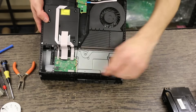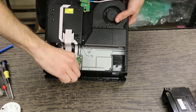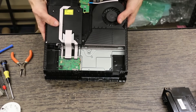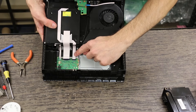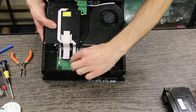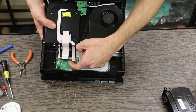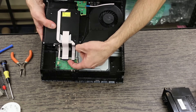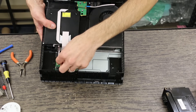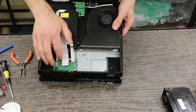Now you get a look at the connectors in here. We've got three ribbon cables and the wifi cable connector. For the wifi cable connector we're just going to take our pliers and pull it out. We've got a small cable, a large wide cable, and a medium cable. The medium cable actually just pulls straight out. The large cable you have to be a little more careful — there's a black tab here, you have to pull up on each end of it like that, so it's pulled up and then it just slides out. The small one is the same as the first one and just pulls right out. So now all the cable connectors are loose and ready to go.